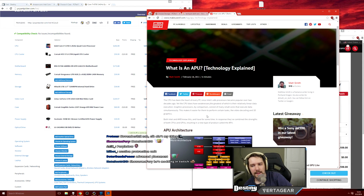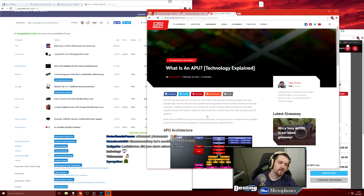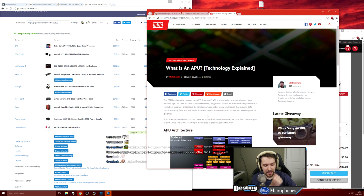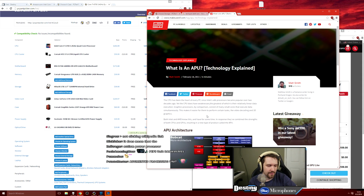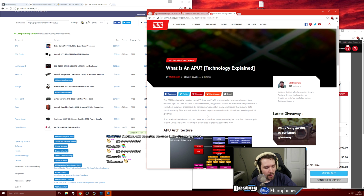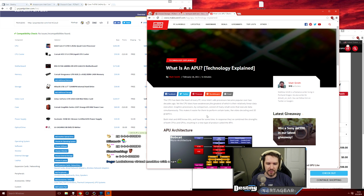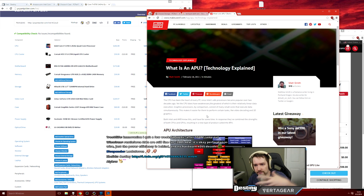Okay, so sometimes people will use integrated graphics. For a long time, AMD chips were able to edge out Intel chips in budget builds because AMD chips offered very, very good APUs. APU basically just means integrated graphics. It's your onboard video system. Now, in a normal GPU, the way that it works is the GPU will store all of the textures that it needs for your game into something called the VRAM, your video RAM. So the video RAM is a big buffer that the GPU is painting pictures and working with.